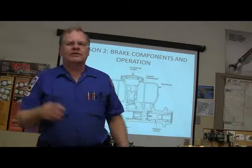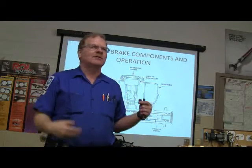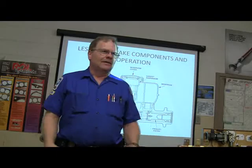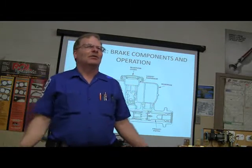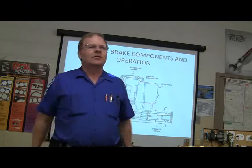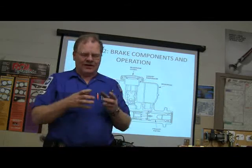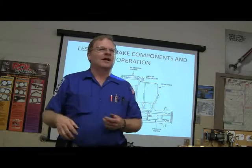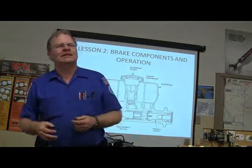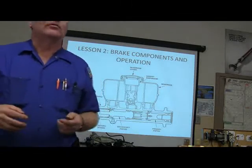Years ago, when I first started in this business, 40 years ago or whatever, we used to rebuild master cylinders. And every time we did brakes, one of the standard things you did, particularly on drum brakes, is you rebuilt the wheel cylinders. You'd hone them out and you'd put new cups in them. The guy that I worked for had various different sizes of cups up there. You'd use the same springs and everything. He wouldn't have boots to fit every one of them, but usually the boots were okay.